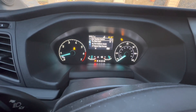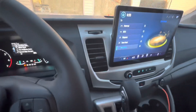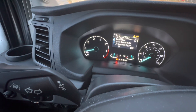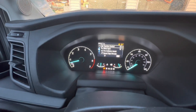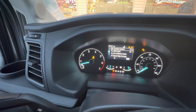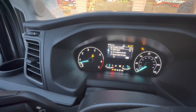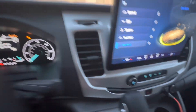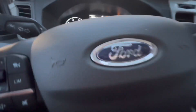I pulled over and stopped, and I'm kind of just learning here. If I put this in normal mode, traction control engages on its own. But I did just realize that if you put it in Mud & Ruts, traction control shuts itself off automatically. So that's probably your easiest go-to for disengaging traction control — just hit the Mud and Ruts mode and it'll turn it off for you. Kind of nice.